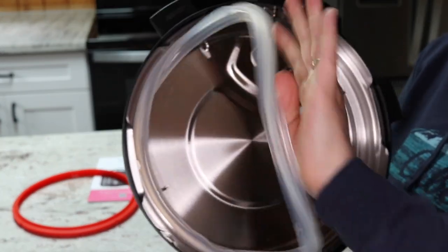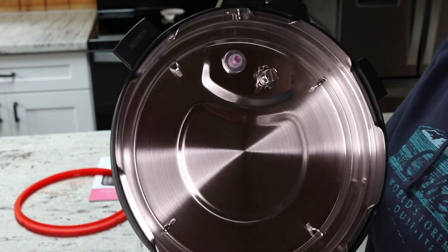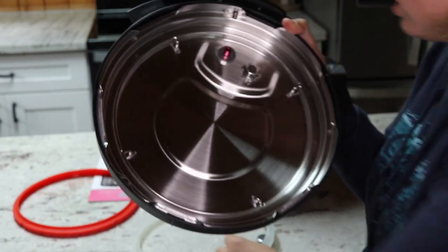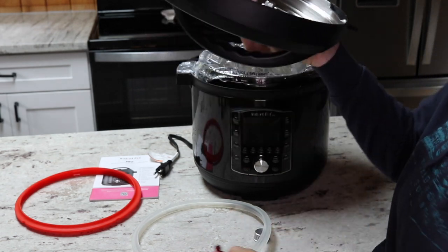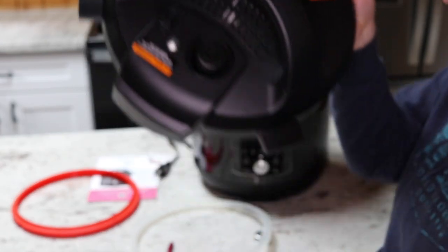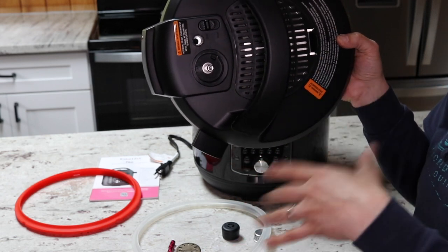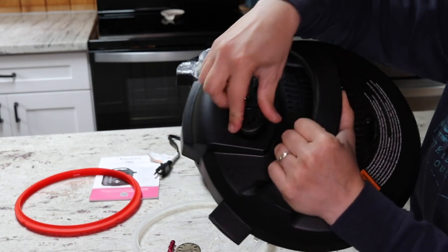Now I'll take off all the removable pieces of the lid. The cap comes off first, then the sealing ring pulls all the way out. The pressure pin has a silicone cap on the end that pops off — make sure you don't lose that cap because the pot will not come to pressure without it. Once you remove the cap the pin just falls through the hole in the lid. Finally, the plastic cover over the steam release and the steam release weight also come off. The whole lid is dishwasher safe — you can throw it in on the top rack assembled or disassembled.